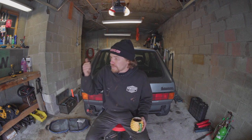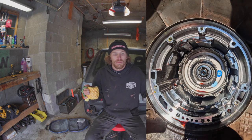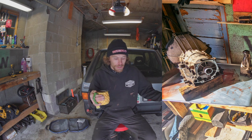I ordered the flex plate, a rebuild kit, the shift kit, the output shaft and tail housing, and the transfer case — I bought all that ahead of time. The first thing to do is obviously pull the transmission and the drive shaft. I got the transmission in here, started taking it apart. Taking apart the transmission is honestly not hard — requires basically no special tools. You need a couple things to press on, some basic knowledge, and you might want to pick up a shop manual, which was pretty helpful.